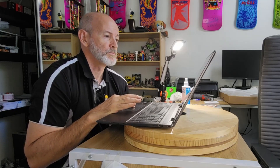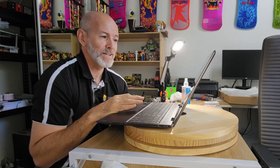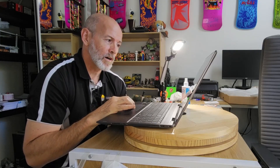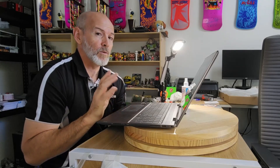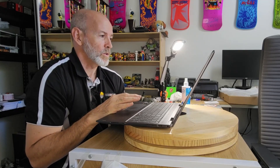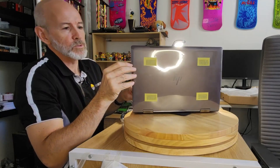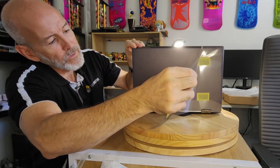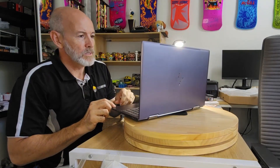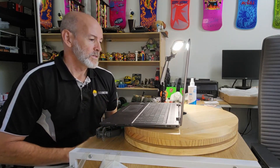Just giving it a little clean to get the grubbiness off so it looks nice and new. You want to give it back looking as good as new or at the very least better than when you first received it. The client also asked me to give it a look over because it's pretty slow. I thought it was going to be a pain for them to use but she said the loaner machine — which was like a Pentium — was a thousand times faster than this one, which strikes me as odd. I think this is an A9 with five compute cores — two CPU cores plus three graphics cores — so essentially a dual-core CPU.